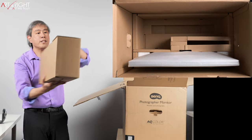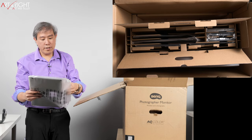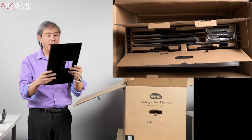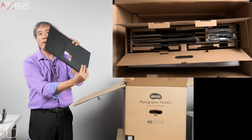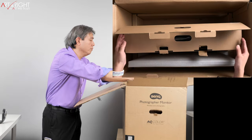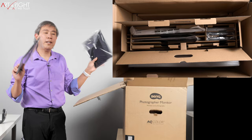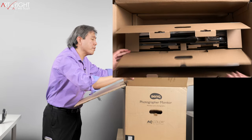Inside this box is a shading hood. Let's quickly take a look at it. Like all BenQ SW displays that came before it, this comes with a shading hood, which is great, and the shading hood does have the felt lining on the inside to minimize any type of reflection from the environment and absorb all the light. The nice thing about this shading hood is that it has a larger opening now, so you can drop in the i1 Display Pro or i1 Display Pro Plus without having to insert the cable the other way — an improvement in the shading hood. It also comes with extension pieces so that you can use the SW271C in a vertical orientation and still attach the shading hood. A really nice touch — most people don't use these shading hoods, but they are quite a great accessory, especially in a vertical orientation.